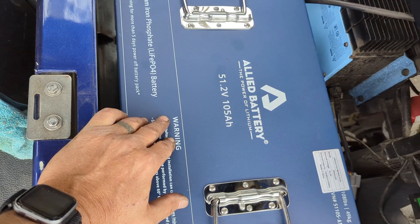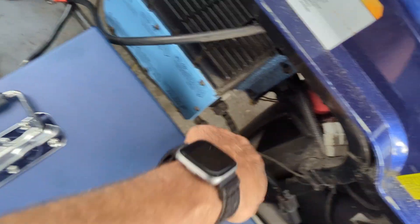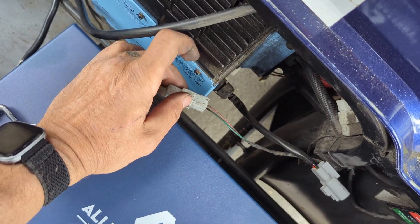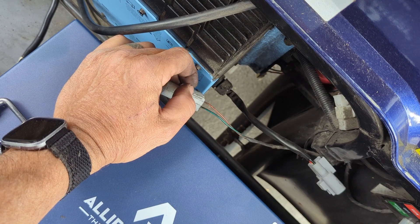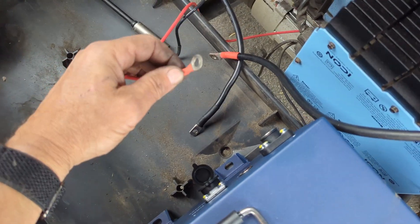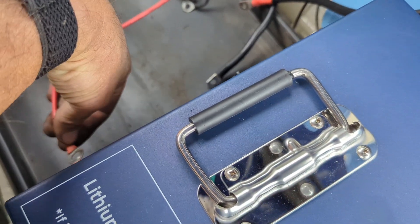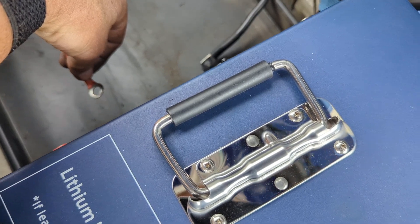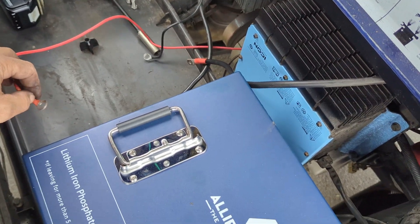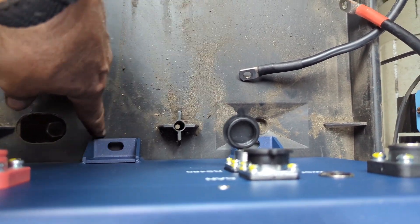This is the commercial Allied 105-amp-hour 48-volt battery. A couple people have told me in the past that you have to modify the wires coming from the Icon charger to make the cart not believe that it's in charge mode. What we're going to do — and I already tested it — the leads previously connected to the lead-acid or AGM batteries, we're going to install these onto the Allied terminals, tricking it so it does not think it's in charge mode or park mode. I've already connected them and tested it.